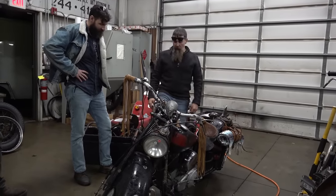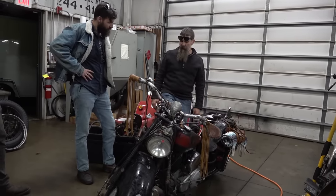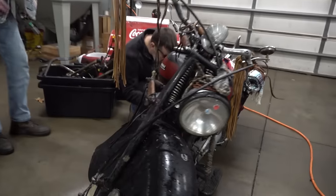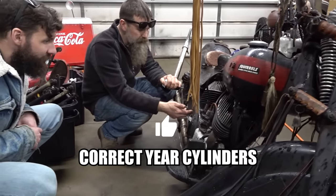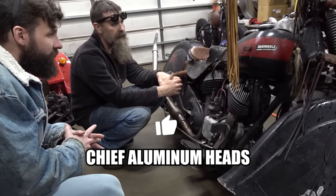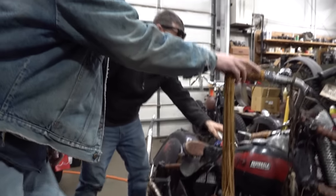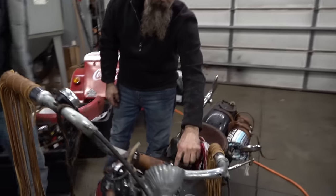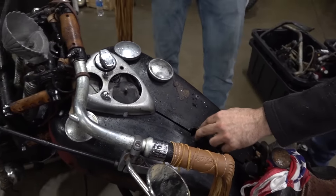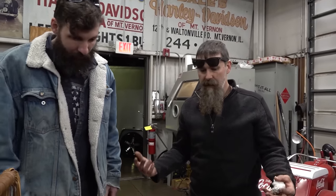You've got an aluminum oil pump - 1948 was the first year for aluminum. So '48 to '53 the Chiefs used that oil pump, so that's the proper oil pump. You've got square-based cylinders, so the cylinders are the right year and era. The heads are Chief aluminum heads, right era. The gas tanks - while that looks like a '48 emblem, they're round right here. And the round, if I'm not mistaken, is scout versus chief - I think it's square for chief. So they might be scout gas tanks, but it's not the end of the world.